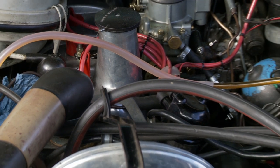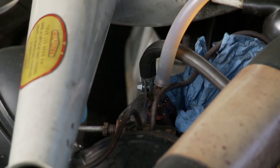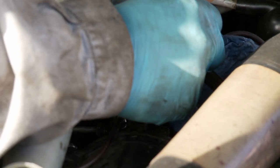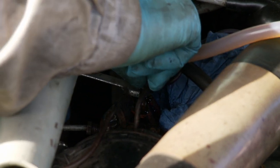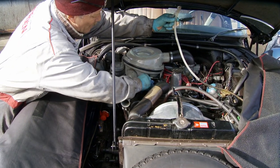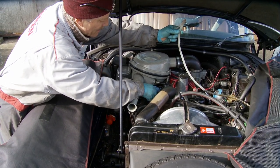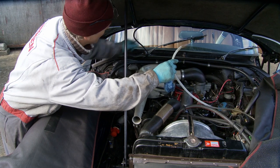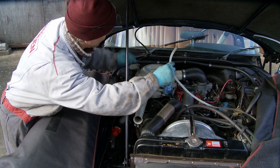Let the brake off and push it on again until the fluid coming through the pipe is clear. So we've bled the brakes — that's all we need to do now. Tighten up the bleed nipple and remove the pipe, trying to spill as little as possible. Drain it back into the tank and wipe out any spillage immediately. You can wash it down with water with LHS; with LHM you can use brake cleaner or any other solvent. Finally, put the covers back on the bleed nipples. So the brakes and the hydraulic system are bled.